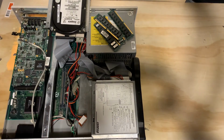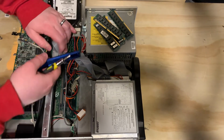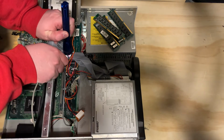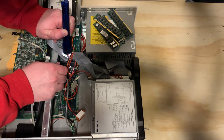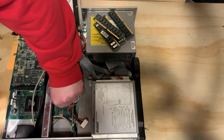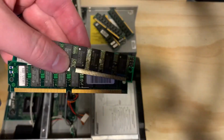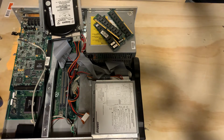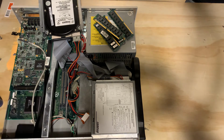Yeah, the clips on this thing are extraordinarily strong. All right, those are at least loose. And these needed to go anyway. If you notice, one is silver plated and the other one is gold plated. Little trick, well, not trick, but a tip with memory modules back in this day. If your slots themselves are gold, you want gold plated memory. Silver, silver. Match up the colors.